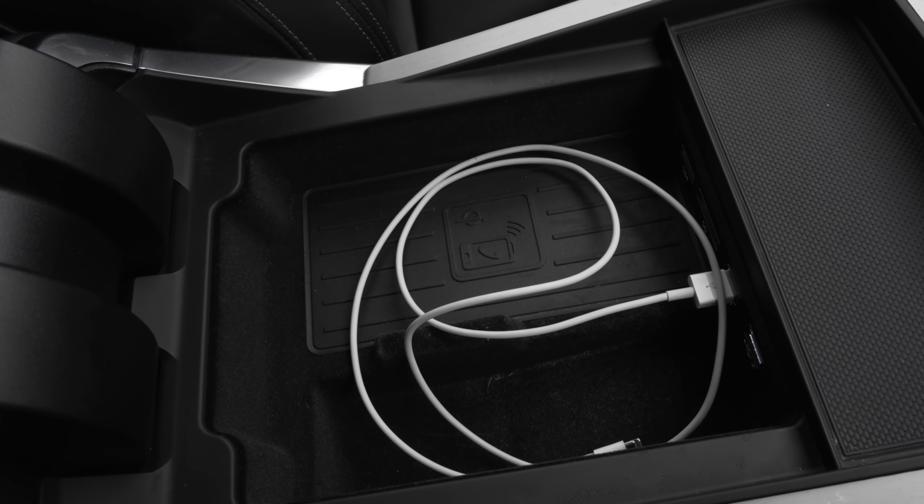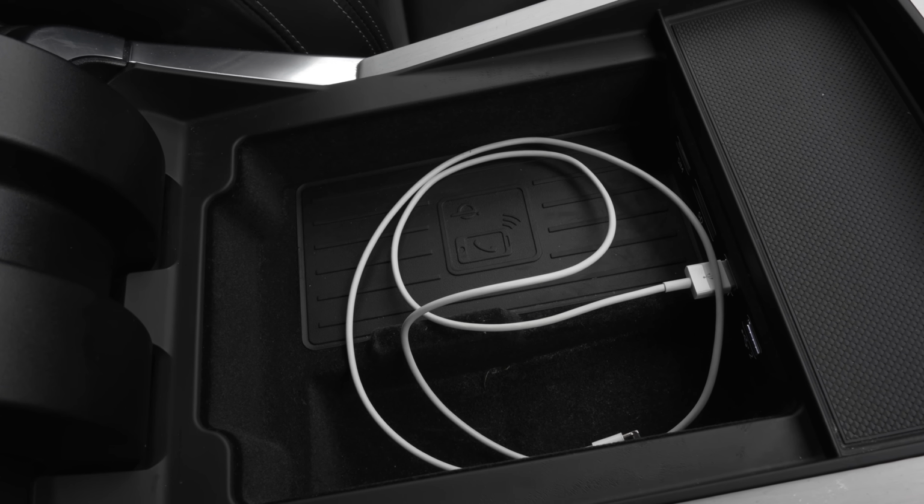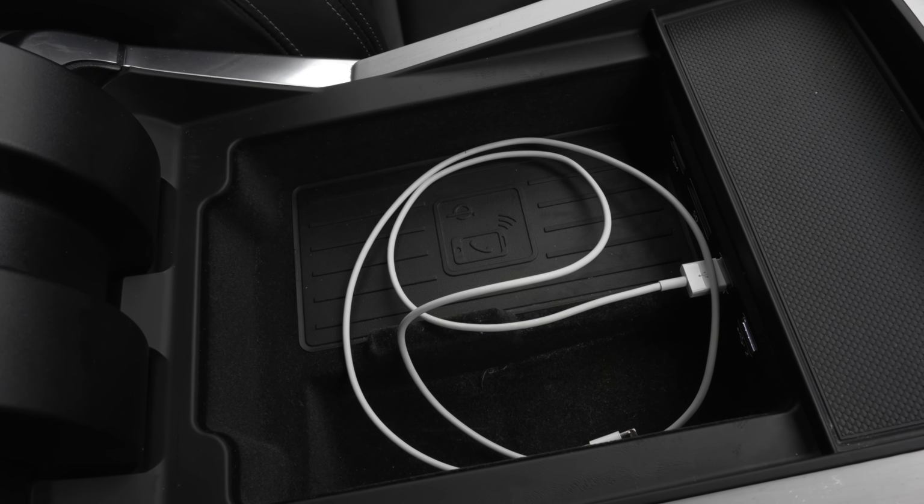With that done, establish what kind of CarPlay connection you're operating. If it's wired, you're going to be connecting to your car via a USB or USB-C to Lightning cable, and this is going to be the first place that I would check. Lightning cables aren't going to work forever, and if you've had a cable living in your car for months or even years, probably subjected to extreme temperatures, maybe getting twisted and bent around quite a lot, there is a chance that your cable has stopped working, so try a different one.